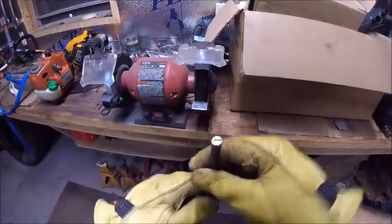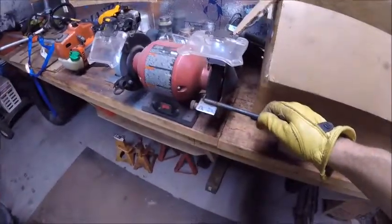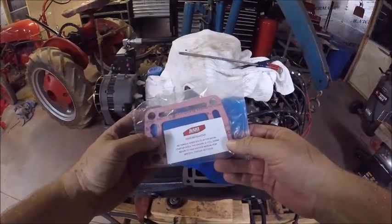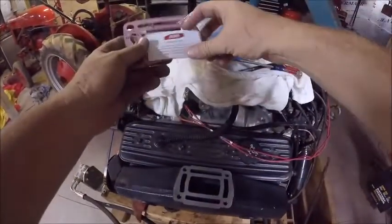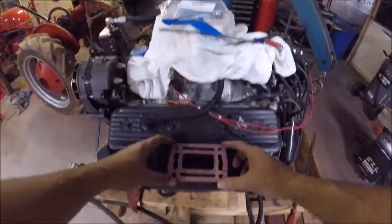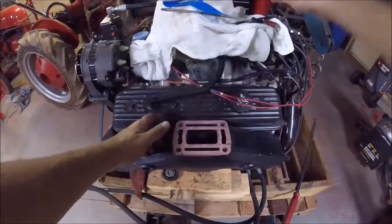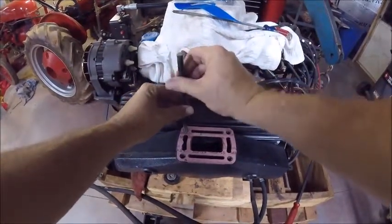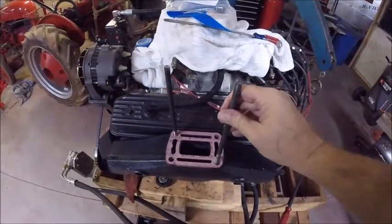We got the head cut off and the screwdriver slot made. Need to clean these threads — they're a little rusty. Now, the gasket note says: re-torque riser bolts after initial startup while the engine is still warm. So you want to do that once it gets warm. Set the gasket down — notice it can move around a little bit, so you want to make sure you get a good seal. Hence the guide bolts in opposite corners so your seal will do its job. Just get them tight enough to hold the gasket in place.